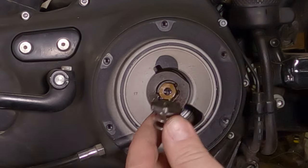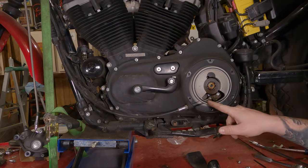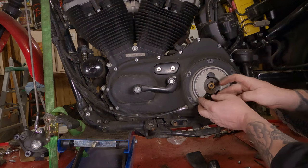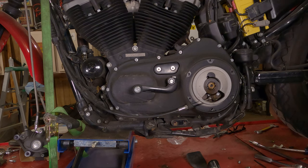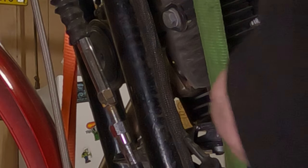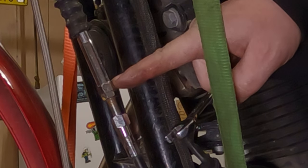We're going to take that piece off and put it inside our clutch cover. Now to replace our seal we're going to take a knife and put it underneath here and peel this seal right on out — or maybe we can use our fingernails. Peel that off. If you're saving it for some reason, set it in a clean location off to the side. To get the clutch cable out we have to undo the clutch tension here on the adjuster, so we'll take the jam nut.